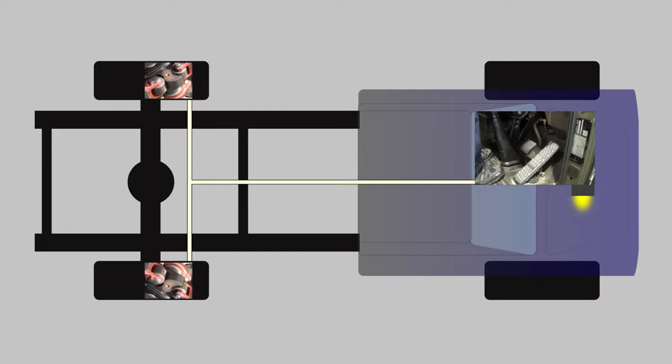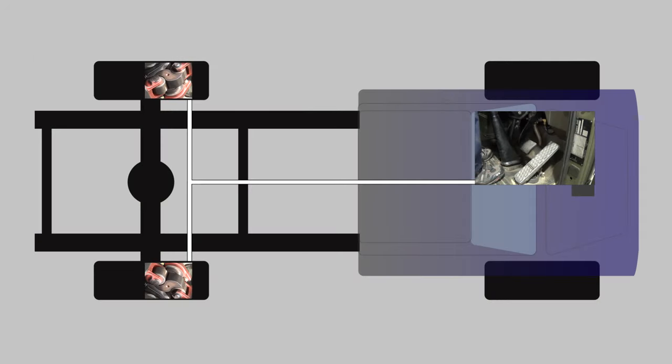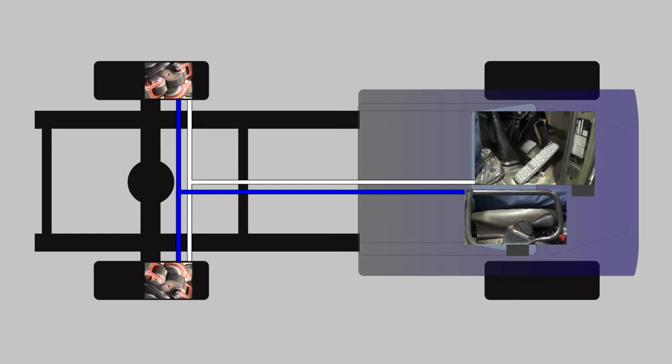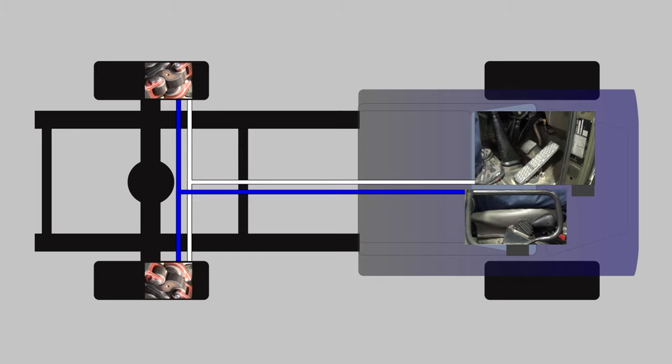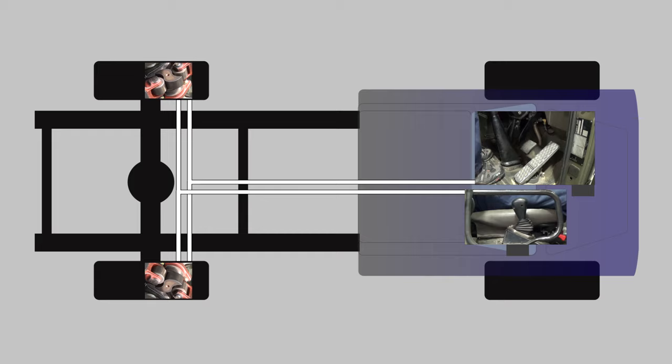But that's not so bad though, is it? It just takes a bit longer for the brakes to be released. Although, what damage are you doing by trying to drive off with the brakes still applied? Let's now put the secondary and parking brakes in and see what happens there. To apply the park brakes, the driver operates the hand control valve which exhausts the air from the secondary circuit, allowing the power springs to apply the brakes. However, with a delay between applying the park brake lever and the park brakes actually coming on, if you wanted to apply the park brakes in a hurry, well — you'll have to wait. Let's rearrange this system with some quick release valves and see what difference they can make in speeding up these laggy brake operations.